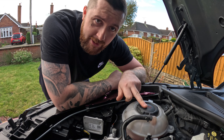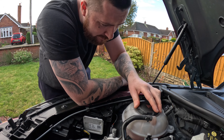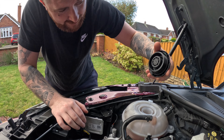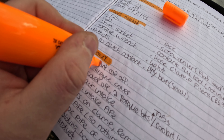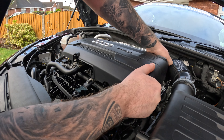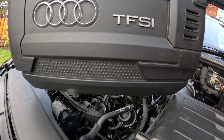The first thing we're going to do is take off the coolant cap. This is to release any pressure in the hoses — it's a pressurised system and there will be a bit in there. So take that off — that's step one. Step two: remove the engine cover, which just pulls up. Then remove this coolant line from its holders, and with your T25 undo the two bolts to remove the top cover.